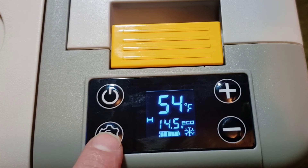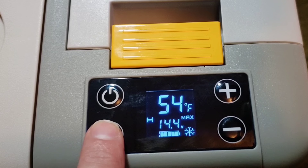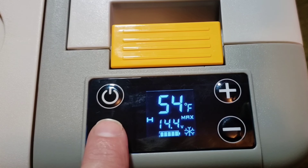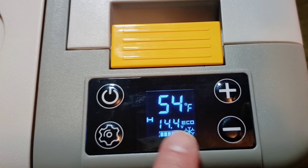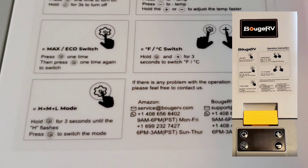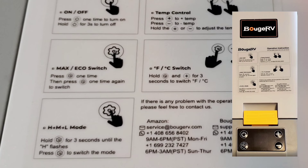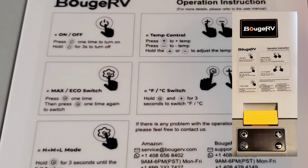Your settings for putting it in Eco or Max mode are right here. You just push and you can see it blinking — push again and it goes to Max mode. Now it's going to use 45 watts of power to get that temperature down faster. Push it once more and now we're in Eco, using only 36 watts, which is fine for me — I want the battery to last as long as possible. In case you ever forget, they have an instructions panel right here. You can take it off since it's a sticker, but I'm leaving it on — it's nice to have there in case someone unfamiliar operates it, like my wife, kids, or grandkids.